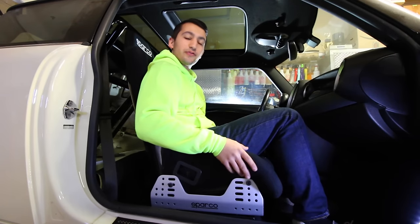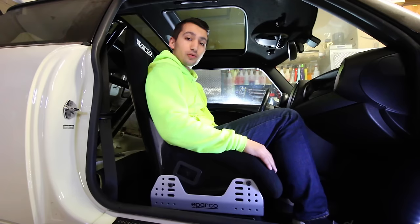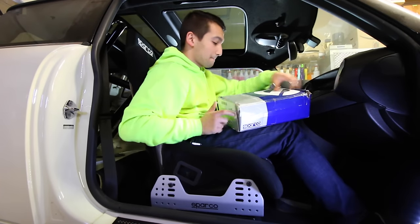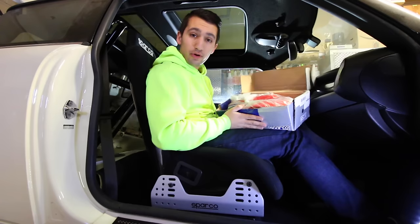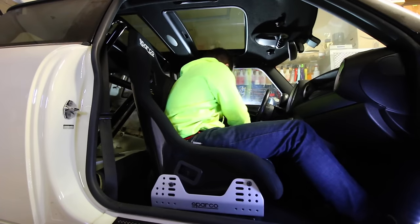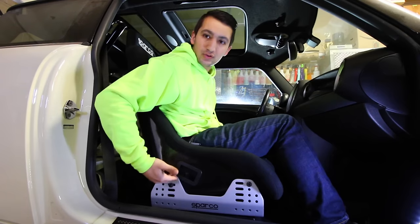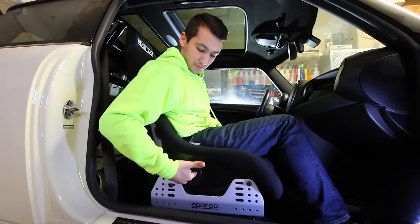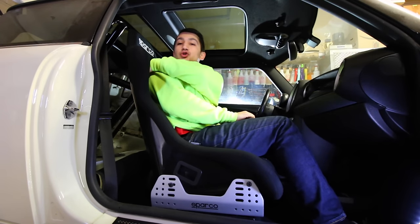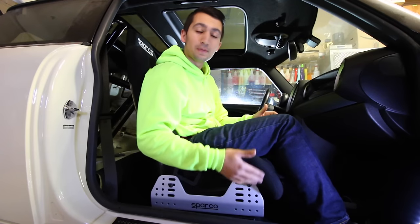If I go with a fixed bucket seat like this, I'd be making the car a dedicated track car where I won't really be able to legally drive it on the road. With a setup like this I can't use my stock seat belts, but with six-point aftermarket Sparco harnesses I can have seat belts that work - however they're not street legal. The six points: two mount in the crotch and go underneath the seat, two attach through the side mounts on each side, and two more attach up to the harness bar in the back through the shoulder area.